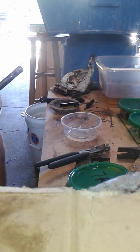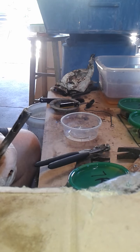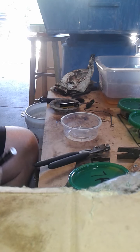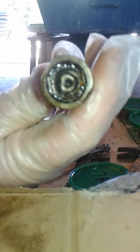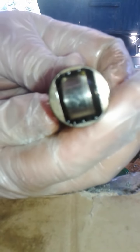I'm going to get a lifter. Make sure you keep these things in order, because you want to put them back where you got them. Now this is your lifter — you can see this thing is just nasty. There's so much crap in there, it's ridiculous.